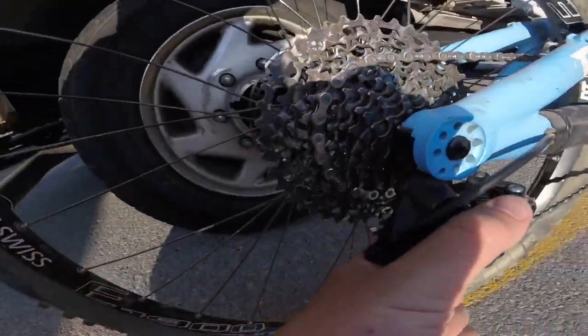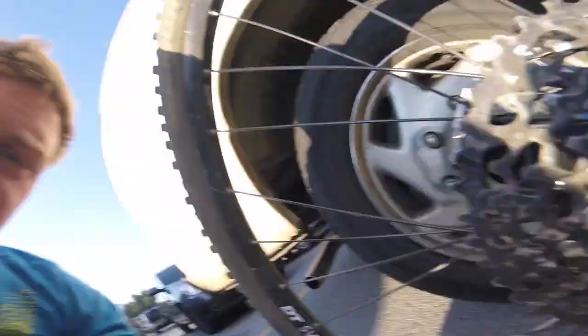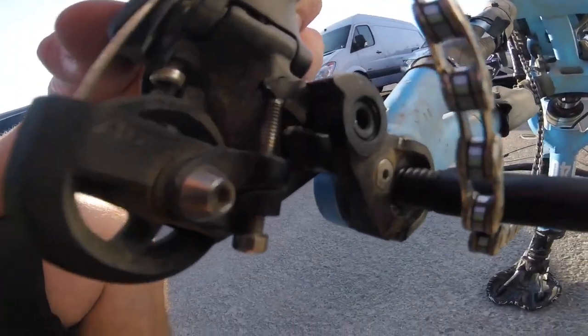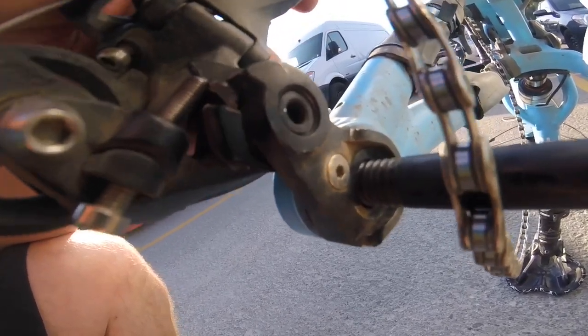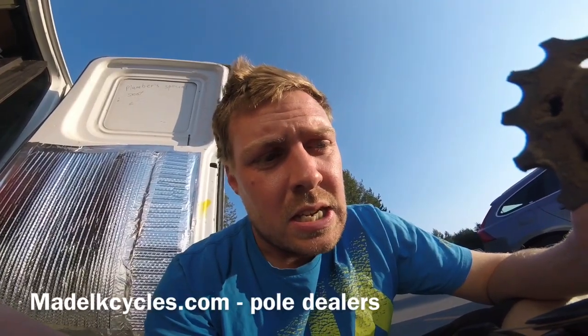Unfortunately now I have to borrow a GT trail bike — I can't pedal anymore. The failure has come from the GX derailleur, which apparently is a warranty job because they use different metals. As you can see, this here is loose and you can't loosen or tighten the bolt. So this broke, and also if you look at the bolt holding the mech onto the hanger, that's stripped. It's a combo of this movement and this movement. I can get the boys at Mad Elks to send me a hanger, or else it's from Pole. I'm just going to ride chainless for the weekend and try to sort that out.